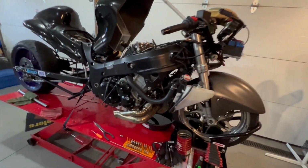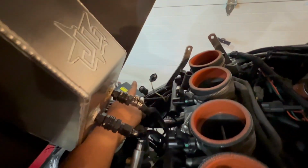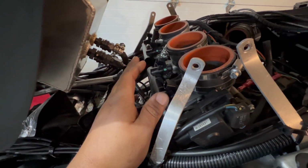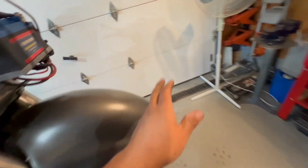We pulled the charge box and we started disconnecting wiring. Up top, we have our coils disconnected. Over here on the back side, we have the injector harness hanging off to the side. I pulled them out to disconnect the center section for the RCC system, which is the fuel pressure regulated system, that has the 1-to-1 boost compensated regulator on there. So that is staying on.